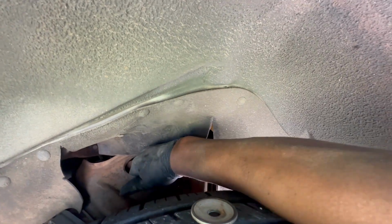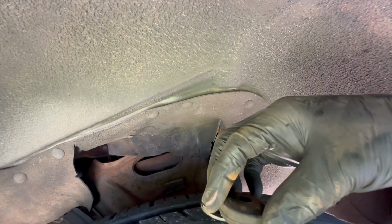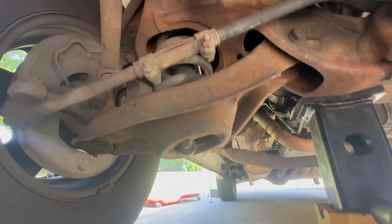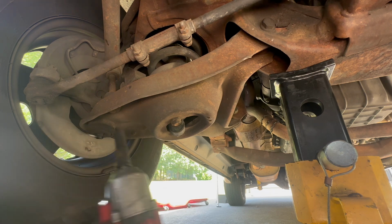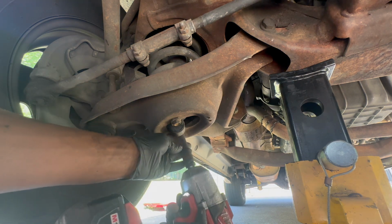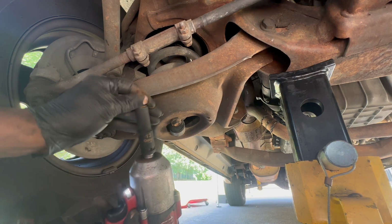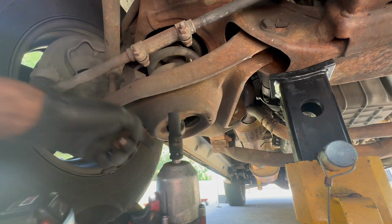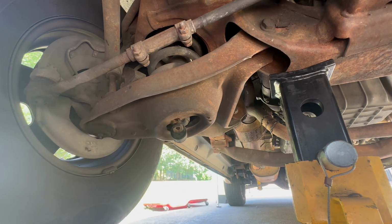There's a bushing in there somewhere, right? So we take that out and let's go back under this underside right here. And you got those two 13 millimeter bolts. A little dusty. We'd want to use some anti-seize or something going back in with them. There you go.